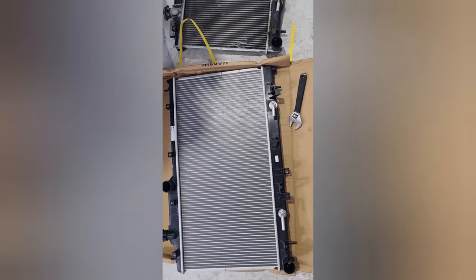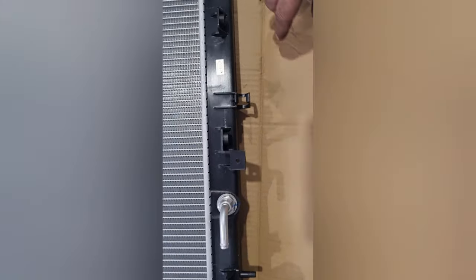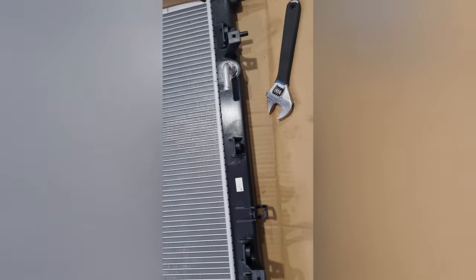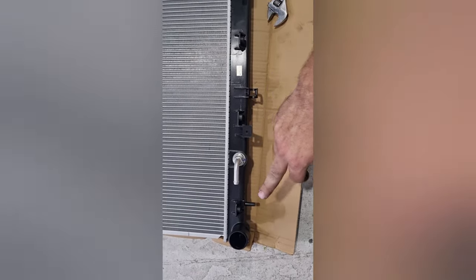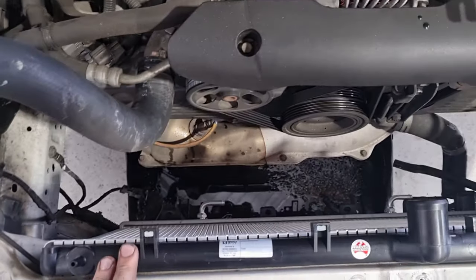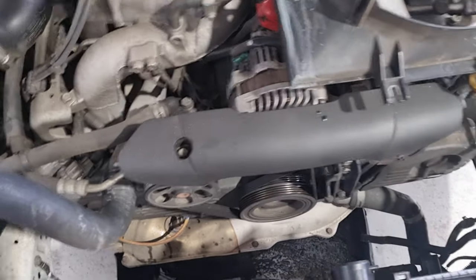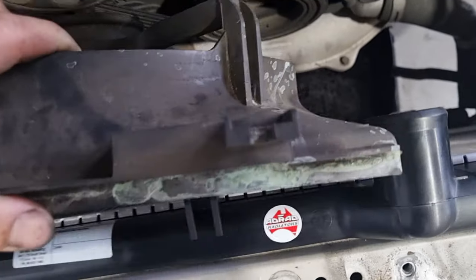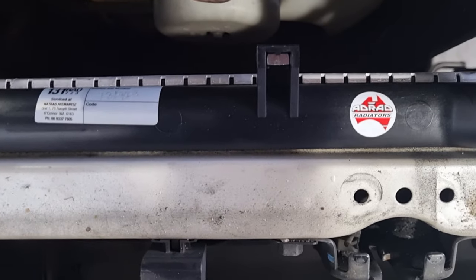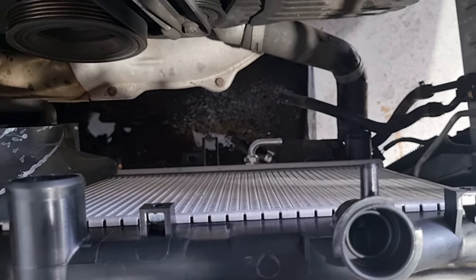Our rubber feet are still in the holders, so that's nice and easy. You just want to check that the radiator is the same, check that your trans cooler nuts are tight — they've obviously marked these when they assembled the radiator, which is a sign they are tight. I always go ahead and check them. Make sure all your brackets are in the right spot and your spouts. Once you've got that all sorted out, we can go ahead and drop it back in. Our radiator is in, sitting in its feet, nice and plumb with the radiator support, so we can drop our fans in.